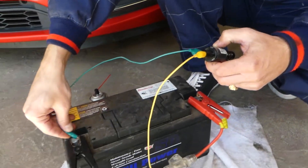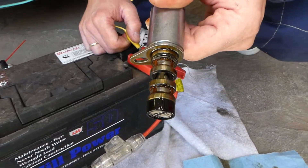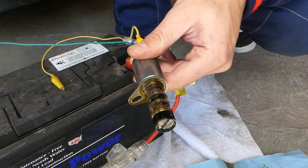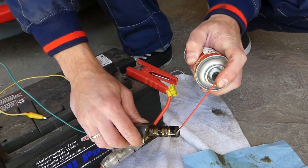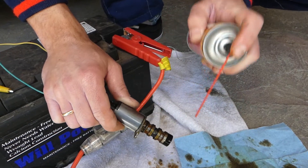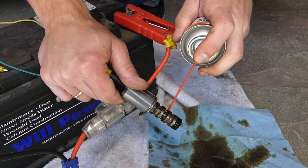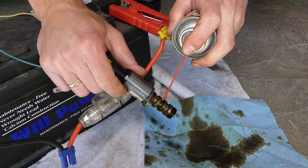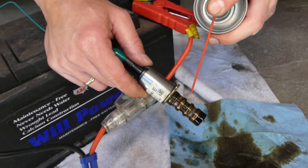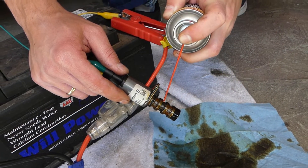Let me show you what will happen. When I connect it, the solenoid will open and close — check it out. So it opens and closes. With the spray, clean the screen on the front first, then clean the little screens on the side. Spray into every hole — you can see all the oil coming out. Then connect it to the battery to have the solenoid open, and while it's open spray again, because when it's open you'll be able to clean more on the inside.